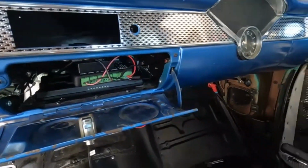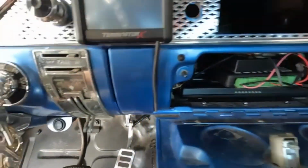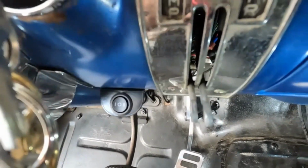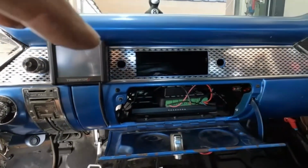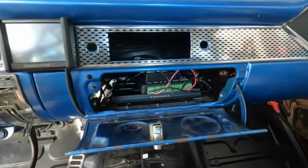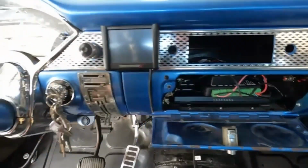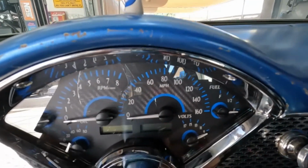Okay, I'm back, still playing around. Got the instructions out, very important here. I started reading through them. As far as setting different things, it's just kind of push button here and there. There's a switch that they give you that's a SW1, SW2. It's just a momentary switch. So you push it and then you let it go and it pops right back out. And it has two positions. And there's actually a couple of wires right here. They go into SW1 and SW2, and then the other end just goes to a ground. And I guess what this does is, as you press this button towards the 1 or the 2, it changes the menus in here, and it lets you program different things and go to different things.